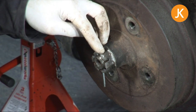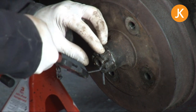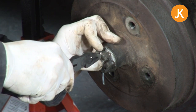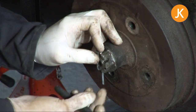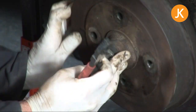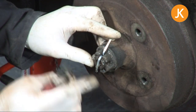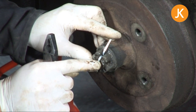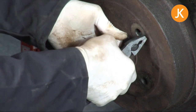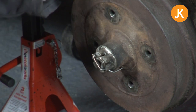And it is a split pin, it separates, so you use your pliers. And personally, I like to use the long side and bring it up. Keep it tight and push it down. And then the shorter side, you just push it over, and we can see that from up here. So you can keep things nice and neat. Some alloy wheels, you may need to actually trim the end of this off, but remember, split pins really, they're one use only unless you've got an absolute emergency. That's it. That's the axle nut all done up again. Job done.